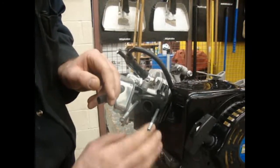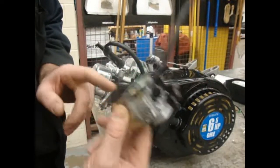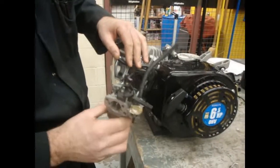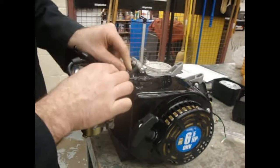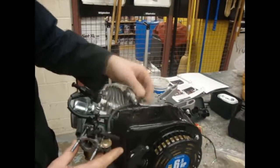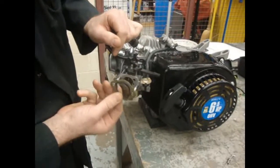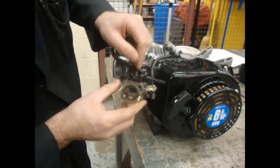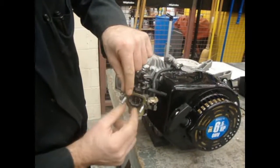This extra little bit of plate keeps the heat of the engine away from the carburetor. We don't want the engine heat going into the carburetor because it will boil the fuel in the fuel bowl. The spark plug wire goes directly in that channel right there. We're going to place the carburetor in — make sure that lines up. The fuel line goes directly on that groove there, underneath the fan shroud bolt, and that will get connected to the fuel tank. Then we've got this big gasket with the rubber insert, and we've got to remember which direction that goes in. There we go — now all the holes in the carburetor are exposed and we're going to have good flow.